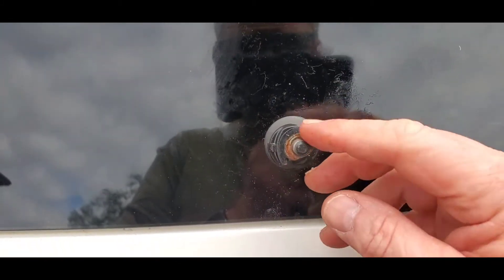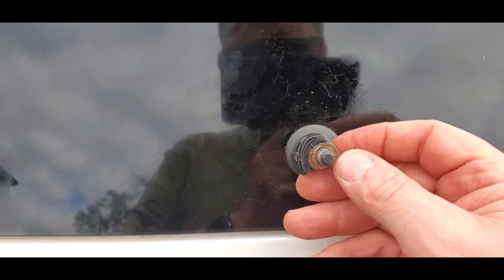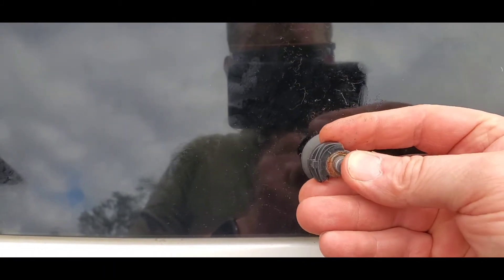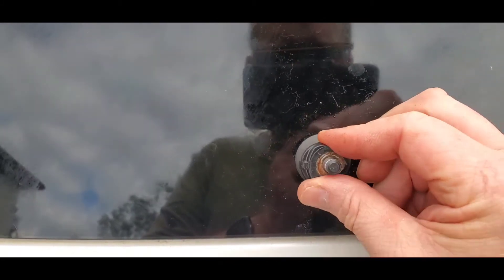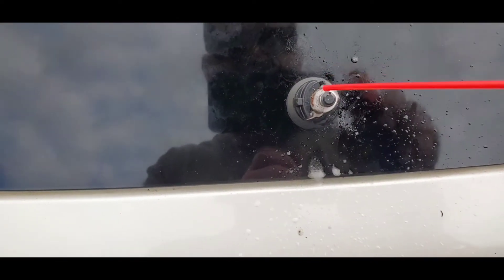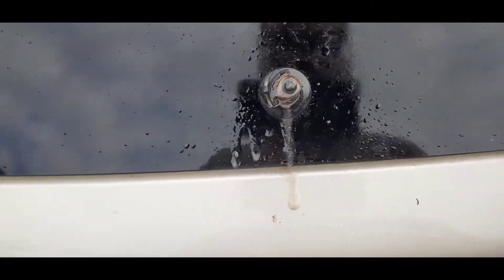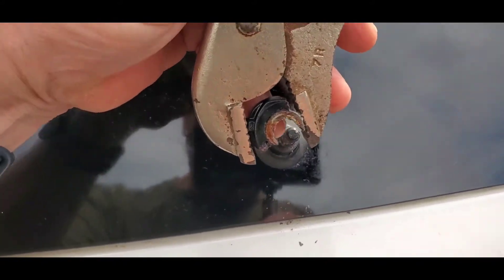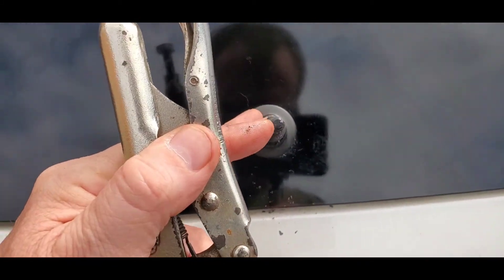What makes this tough is you have to slide this off and there's a lot of corrosion in here. I'll spray WD-40 again and let it penetrate. I can slowly try to slide this out — maybe use some vice grips to help pull it off. I don't want it to crack and break. I got it off off-camera — I put vice grips on it and just wiggled it slightly until it slid off.